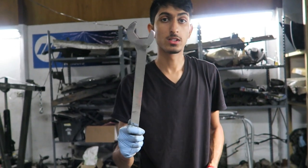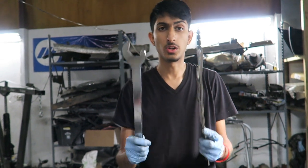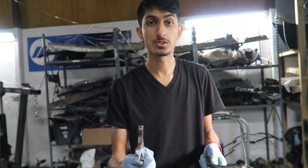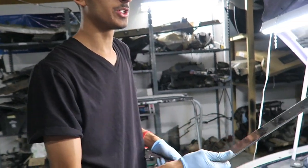Pretty much to do this it takes about 15 to 20 minutes. The main tools you're going to need are the fan clutch removal tools — you can get these on eBay for like 20 or 30 dollars, or you can rent them from your local auto parts store where you pretty much don't pay anything. So basically what you get is a 32 millimeter flat, very skinny wrench.